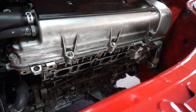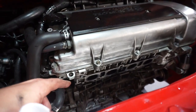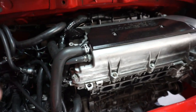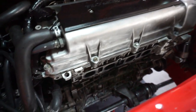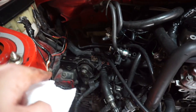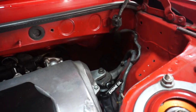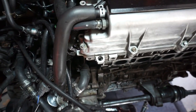Next thing I'm going to do — I got the engine hoist and I want to hoist up the 2zz. I think the easiest way is to put a jack on the oil pan so I can do the motor mount right there, the motor mount back here, and then the motor mount in front, then it'll lower. We'll hang from that motor mount over there — we don't need to undo that one, we're just gonna slide it off. We're not removing the whole engine because the 2zz is still good.